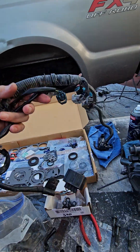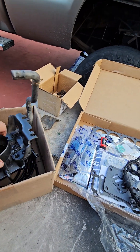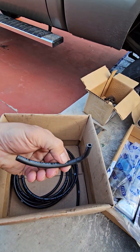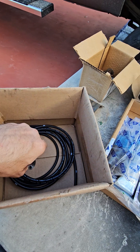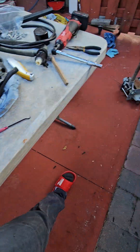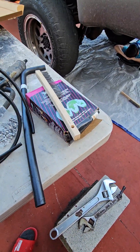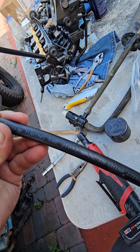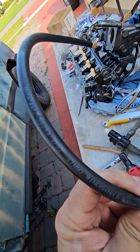This is the injector wire harness, and I've got my throttle body there. For the vacuum hoses I went to AutoZone — that's one of the vacuum lines I bought. You can see it's a 5/32nd. The other vacuum line I bought was this one, also from AutoZone — J1037 — and the size on this one is 9/32nd, which is seven millimeters.